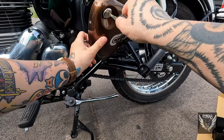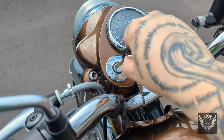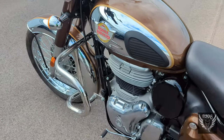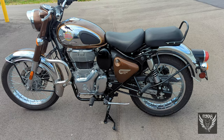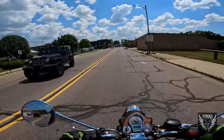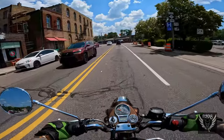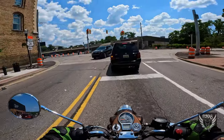When you have everything installed and ready to go, start the bike and let it idle on its own for 10 to 15 minutes so the computer can adjust to the significant increase in airflow. Do not rev it, no matter how badly you want to. Leave it alone and let it do its thing. Once you've let it idle for the appropriate amount of time, you can jump on and give it a ride. For the first 10 miles, I kept the RPMs low and same with the speed — probably not necessary, but I wanted to make double sure everything was properly adjusted.